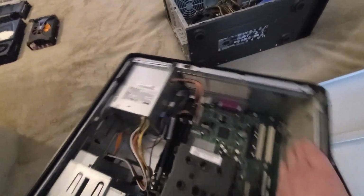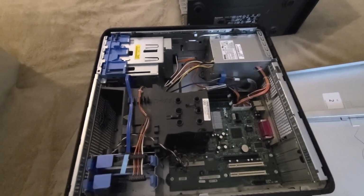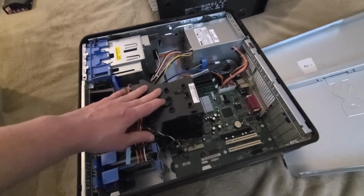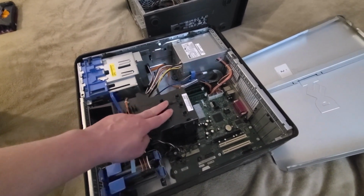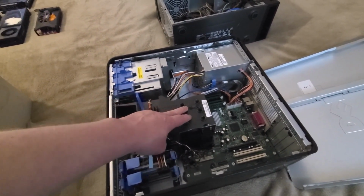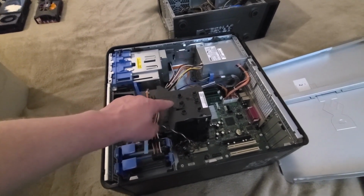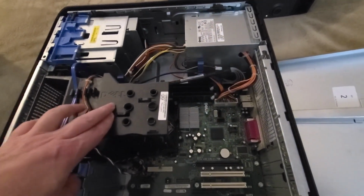Depending on what CPU it has, I do have some Xeons for this, but I don't have the little sticker that reverses the 2 pins. So the next best CPU I have is an E7500. I believe these could take a newer CPU. And this is DDR2 memory.